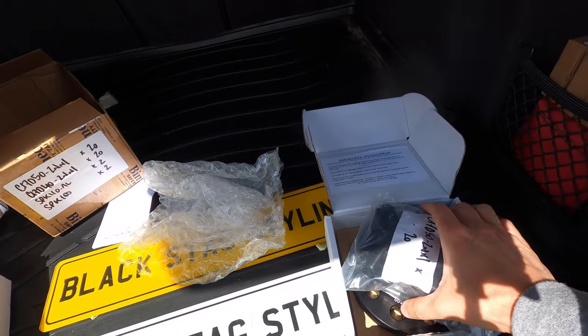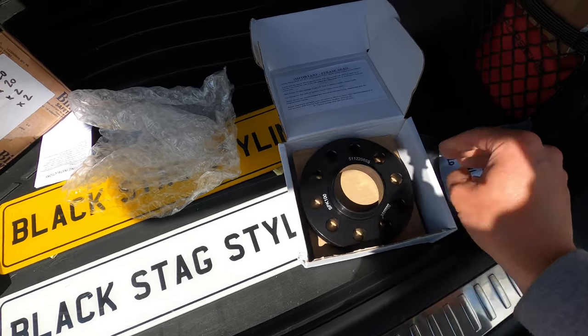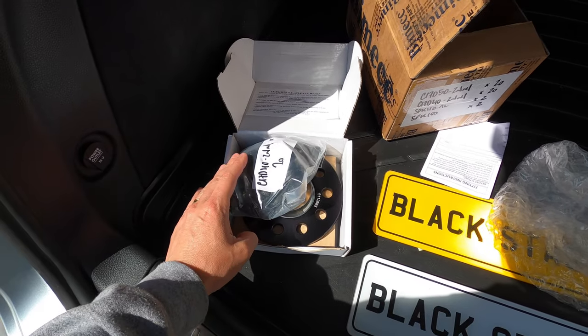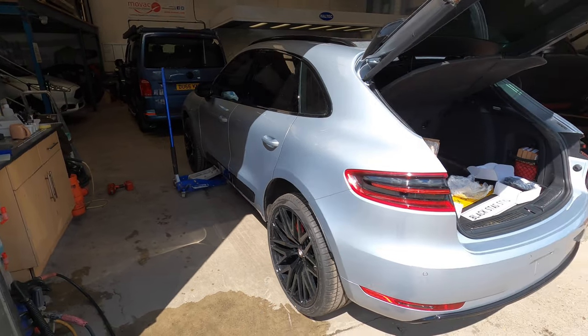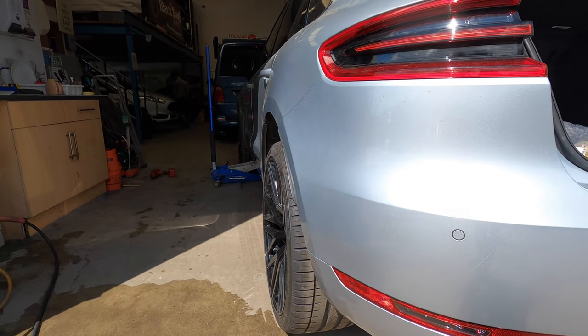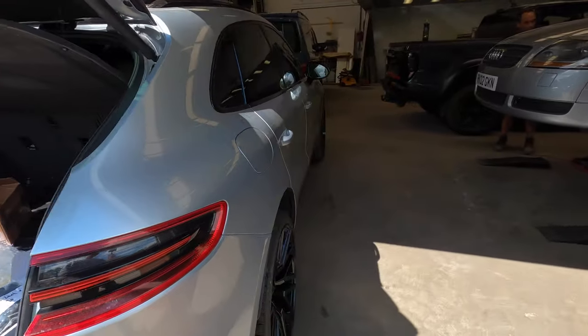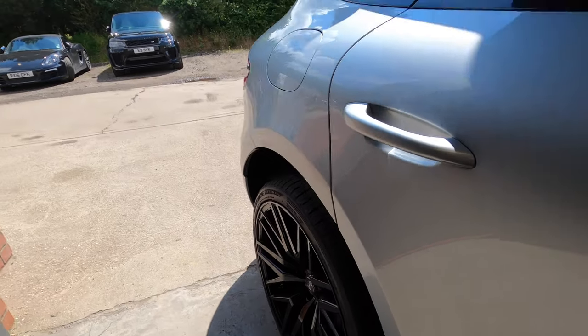It's now time to get the spacers onto the wheels. We are going with 10mm spacers for the front and 20mm for the rear. We've got the 20mm spacers here in black, so they'll look good with the wheels — decent quality spacers, not cheap ones. We've got the new longer bolts to go with the 20mms, and on the other side the 10mm spacers with their new longer bolts as well. Rob is now about to get the wheels off and get the spacers on. If you look down the side of the vehicle, the wheels sit fairly far in on the arches, so the spacers should bring them out nicely.